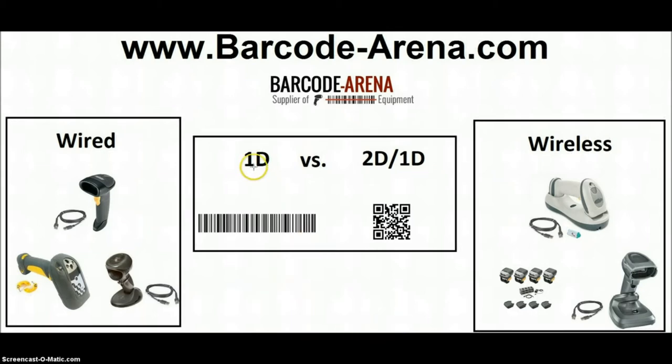We'll start with the types of barcodes, which is another common question: what is a 1D barcode scanner versus a 2D barcode scanner? 1D barcodes are the most common — some people call them a picket fence barcode because all the black lines make it look like a fence. UPC is a term you'll hear often and is actually a type of 1D barcode. There are other types of 1D barcodes — Code 39, Code 128, Interleave 2 of 5 — these are all different symbologies, essentially different fonts.